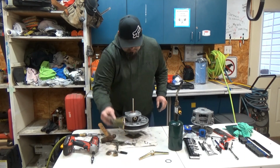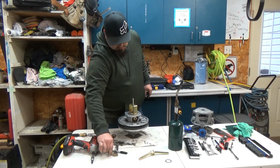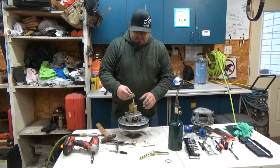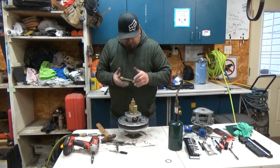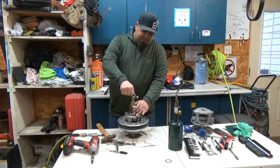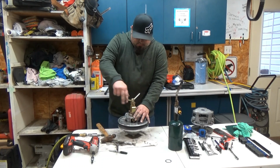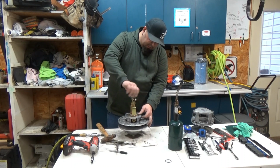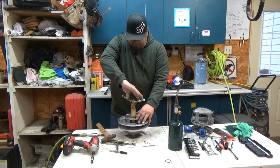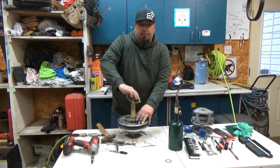Back on your puller. Now what we can do is we can use our old pucks as spacers, so we don't have to screw that thing all the way down, even though this is a speed screw, but look, we're already started. So I just start taking her down slowly, keep her lined up, make sure there's nothing binding.